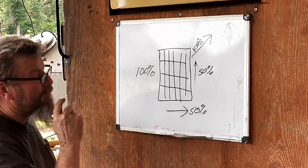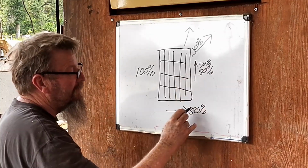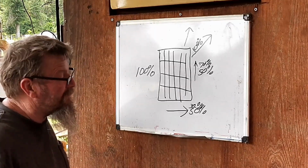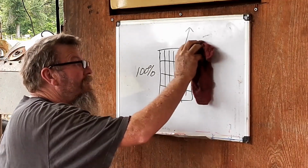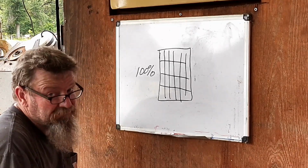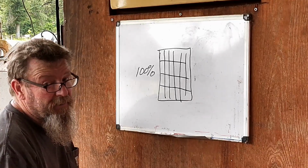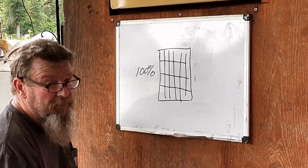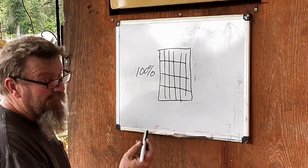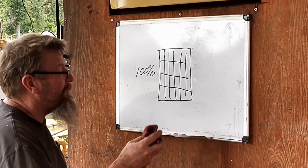And then the more you get on the throttle as you're coming out, you start moving this to 70% and this down to 30 because you just don't need it as much, right? You don't feel all that going. That's not going through your mind, but that's the way it's working. You can't get any more bite out of this tire than what it'll give you. The thing is, the more bite that you can get is going to be by putting more pressure on it. The more you weigh it down, the more it's planted down in the ground, the more bite it has. No ifs, ands, or buts about it. The less bite it has, the less traction it has. That's just it. Okay? So we got to keep that in mind.